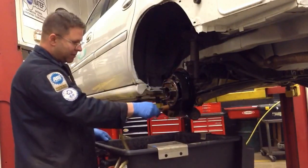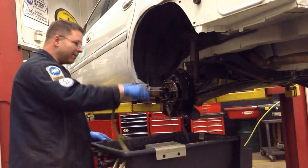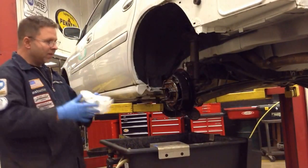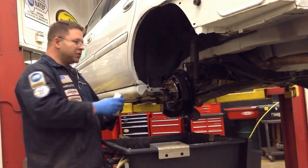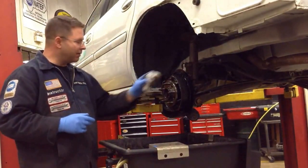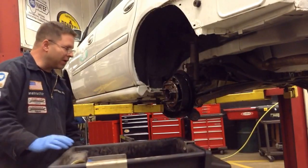A lot of times during a brake inspection, technicians rarely even clean the drum on the big piece. But the professional technician is going to take the time to do what I'm demonstrating for you right now. As I said, the solvent does evaporate, so we don't have to worry about blowing it out with an airline. In fact, that's something you really don't want to do, because brake shoes do contain asbestos, and asbestos is bad for our lungs. When sanding these brake shoes, just a light scuffing — the days of blowing brake dust all around are long since gone. We've certainly got to think of our health while we're out here in the shop.